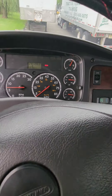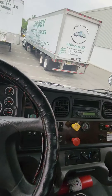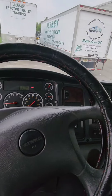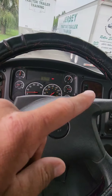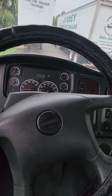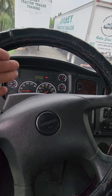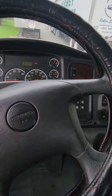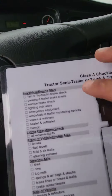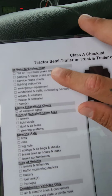That was my governor cutoff valve — it tells me my tanks are full and the system is fully charged. If it goes off while you are doing the in-cab at any point, you have to stop, mention it, and then continue where you were. That is all complete. Now we're going to take a step back because we skipped parking and trailer brake and service brake.